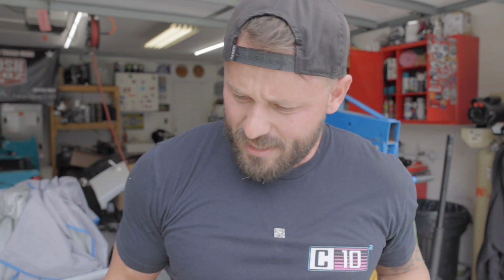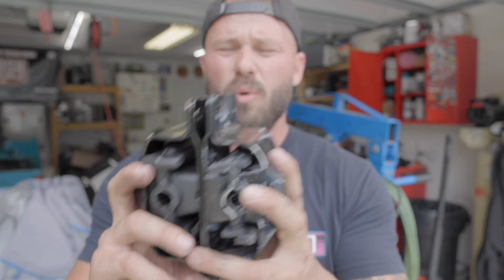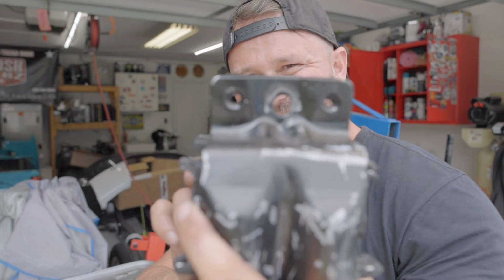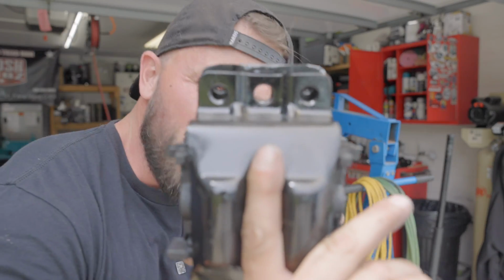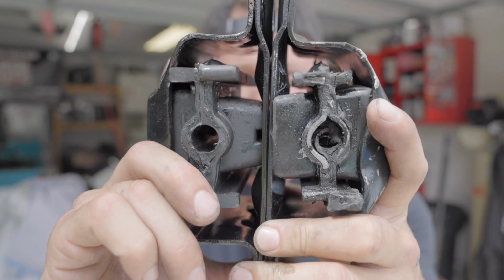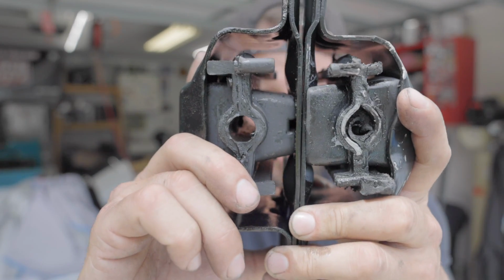Well, if you line this up with this new Duralast motor mount, which by the way, a lot of you guys and gals say that AutoZone is trash, and I'm gonna strongly disagree with you there. Can you see that? The holes, so I put the hole at the bottom. I gotta hide behind this so it focuses. And then you look at this. You see where those engine mount holes are, where that bolt's supposed to go through? So I may not have to modify these at all.